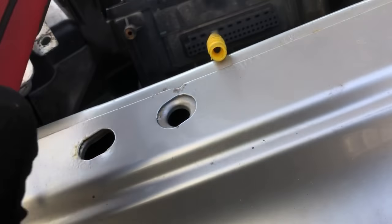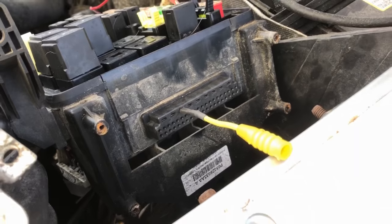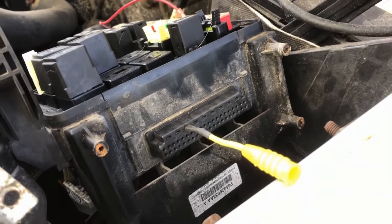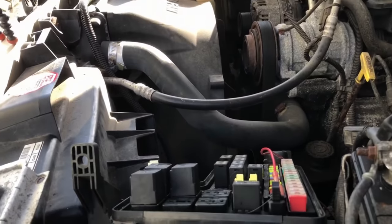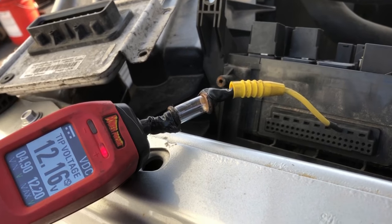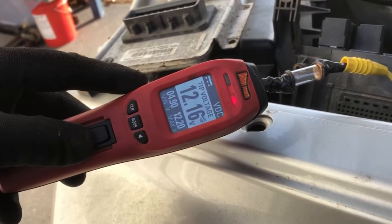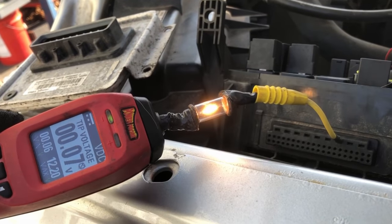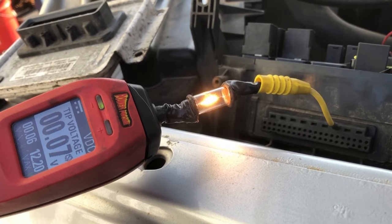Now this is a situation where you really can't back probe the circuit. The best way to test voltage, especially on a circuit that carries current, is to back probe it and do a voltage drop test, because you want to see how the circuit reacts under a load — that's how it operates. If you've seen the video we did on the BMW lift gate motor, you've seen this before: this is just an incandescent bulb put in line with the power probe tip. If we apply ground, power comes into the tip, to the bulb, and we apply ground from the probe end — it lights the bulb. That tells us that this circuit can carry some current.